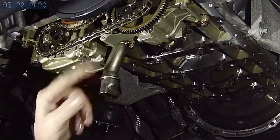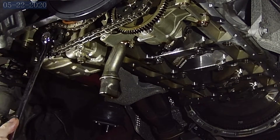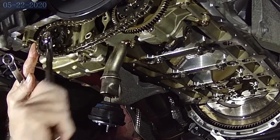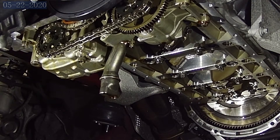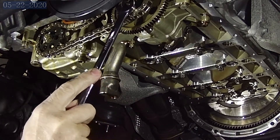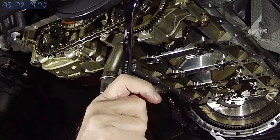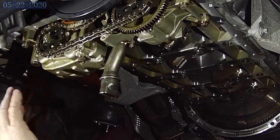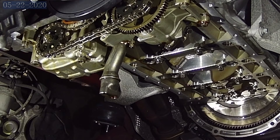We've got a little bit of slop in the chain, so we're going to break these nuts loose. These are right-hand threads — typical threads — and you can see they're not very tight, which will allow us to use a 15mm open-end wrench on the scavenge pump. As you can see, that came apart real easy. We're not going to take the sprockets or the nuts off until we get to the workbench. We just want to break them loose here — it's a little bit easier.